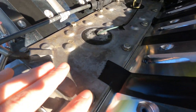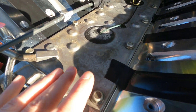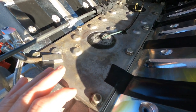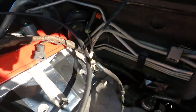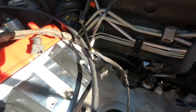Since somebody commented looking for that video, now I'm gonna make it — ask and you shall receive. Just a couple updates because the engine is gonna be the focus of the next video. The valley cover bolts I put in are too tall and they hit the bottom of the intake manifold. We do not want to crack that, so I got new lower-profile bolts coming in tomorrow. We'll swap them out and move some of the wiring harness into place, because when you put the intake manifold in you want the wiring harness below it.